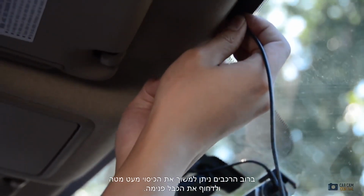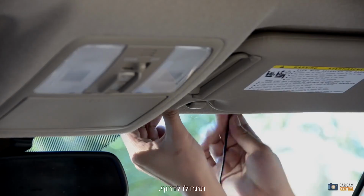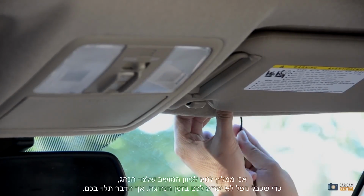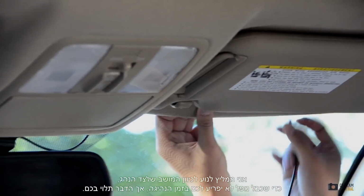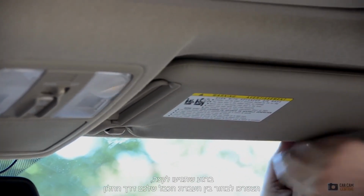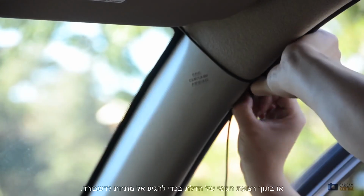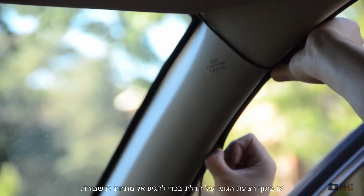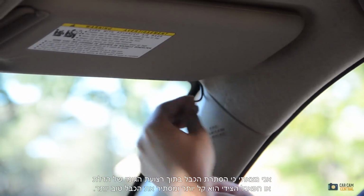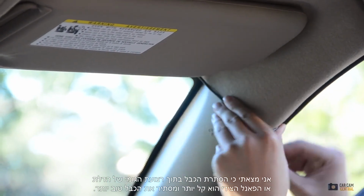On most vehicles, the headliner can be gently pulled down and the wire pushed into it. Start stuffing. I recommend going towards the passenger side as a fallen cable won't interfere with your driving, but it's really up to you. Once you reach the end, you'll have to choose between running your cable down your window or inside the weather stripping to reach the bottom of your dashboard. I found running your cabling inside your weather sealing or side trim is easier and hides more of the cabling.